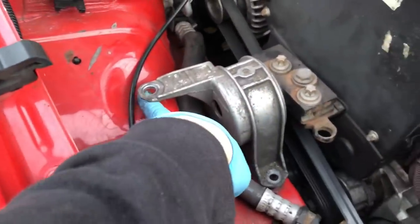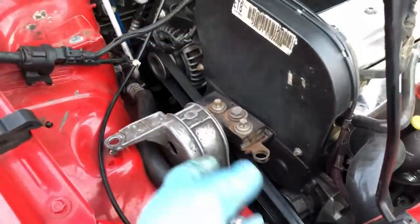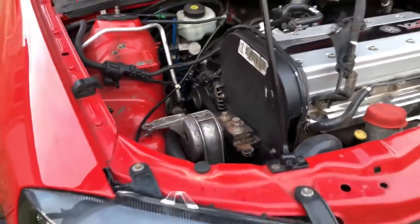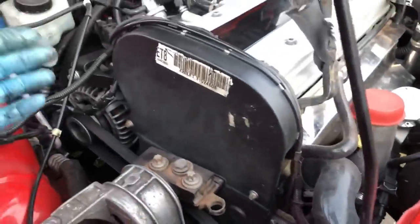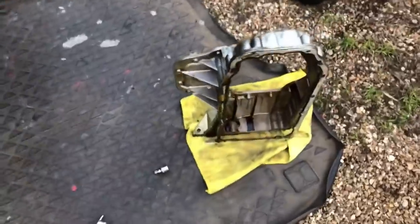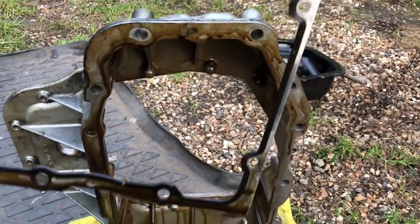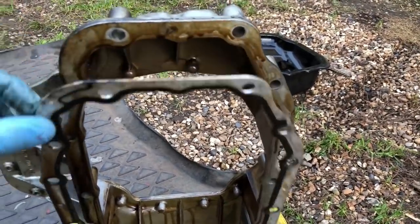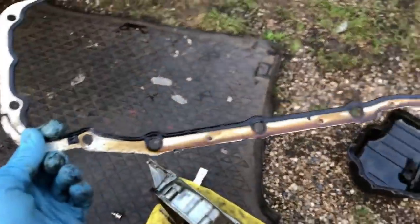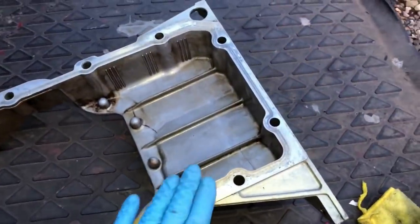The engine's up about two inches — that's all you need for sump clearance. Don't raise it more than that or you'll strain the wiring loom. Now the sump's off, going to give it a proper cleanup. These gaskets are actually GM gaskets, which is either good or worrying — whether they've spent money on proper GM parts or reused the old ones. Going to clean up the sump, get all the crud off, replace the gaskets with proper ones done correctly.